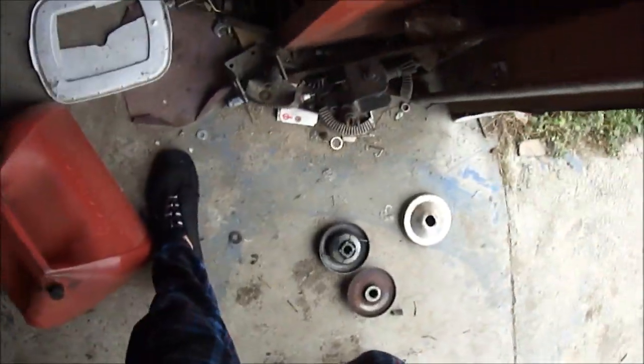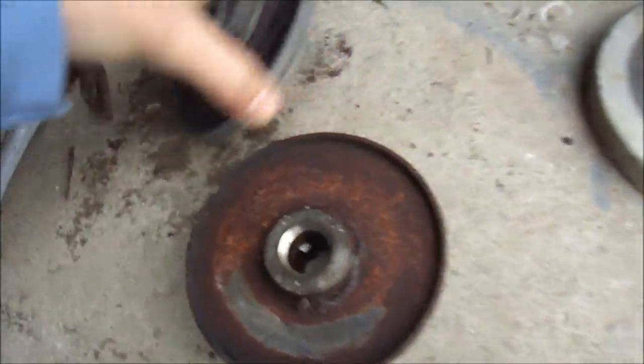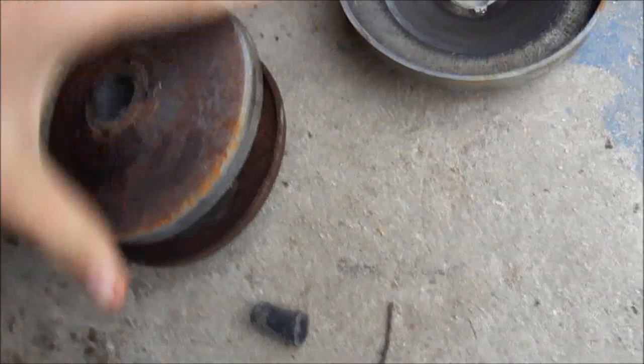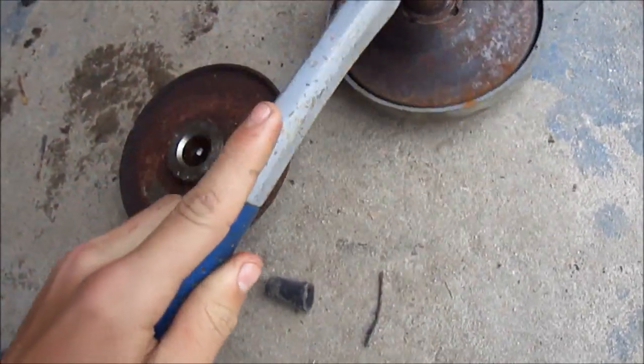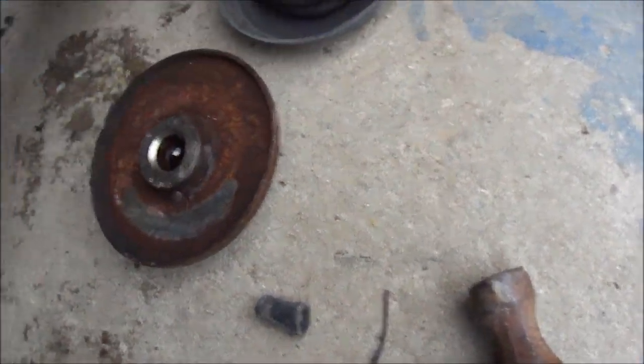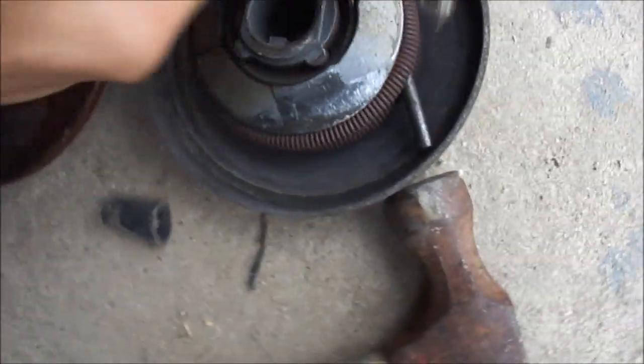Where's my hammer? Okay, I seem to have lost my hammer. Here it is. See here, this piece here moves. This torque converter might still be good, but see here, this piece moves and sits in here like this. These are friction discs — I don't think these are magnets. Some of these clutches had magnets in them, but no, these are friction discs.